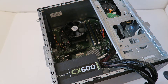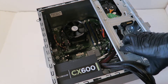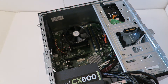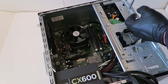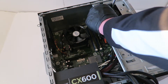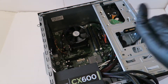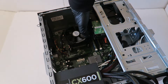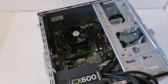Now we're gonna remove the hard drive. Disconnect the SATA cable, then use the Torx T15 screwdriver to remove the four screws. The hard drive is a 3.5-inch and slides out like this. The teardown and processor/CMOS battery upgrade will be covered in a separate video.